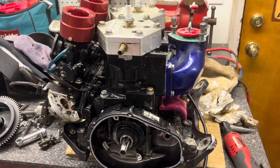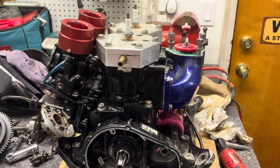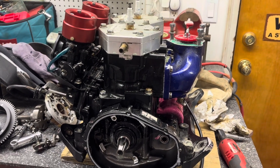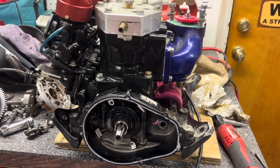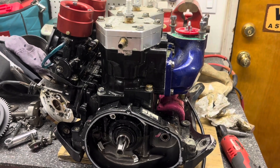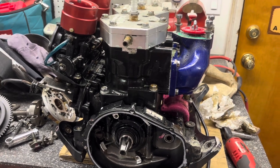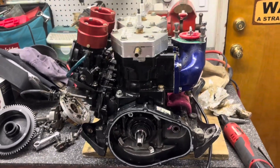Anyway, that's it for this video. Do it on your motors — if you're pulling your ski apart this winter, just try it. It's not going to hurt; your motor's already out. If you got a problem, fix it and it'll keep you from having problems in your season. This also explains why there's so much oil and grease — it was just leaking. And this can cause bad carburetor tuning, so don't always think it's your carburetors. Check your motor too. Thanks for watching — like, subscribe, comment. I work on this stuff all the time and figured it would help you guys.